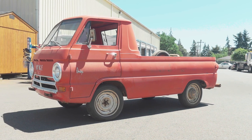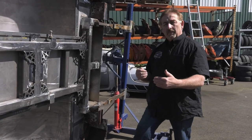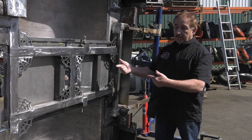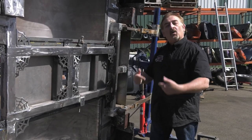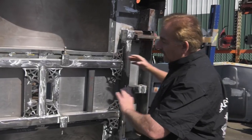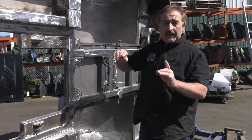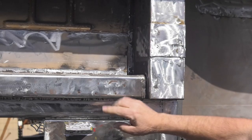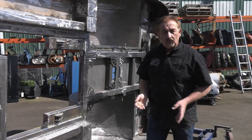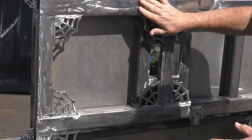So if you recall, our 64 A100 that I introduced last season was just a peach — no rust, just a really good solid truck to start with. But as you can tell looking at this, there's a ton of modifications that had to be made. This little rig was designed to hold a slant six — we've got to make it hold an 800 to 1,000 horsepower Ray Barton Hemi. So we cut the floor out, the main section of the floor. All we had was the original front frame rails when we began what you might call back-halfing the vehicle. All this new shiny stuff you see is brand new boxed-in tubing.